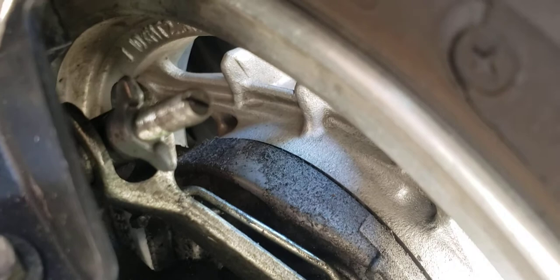It's got the wing nut right there. There's a little flathead screwdriver slot in the back — you can put a flathead screwdriver in the back of the threaded rod. This one I had to put a little needle nose in the front of it to hold the cable because it was a little tough. I oiled it all up — I just bought the scooter — so I backed off that wing nut and come back up here.